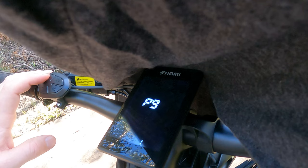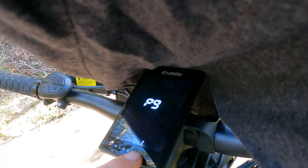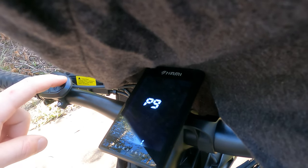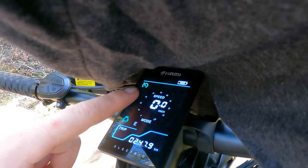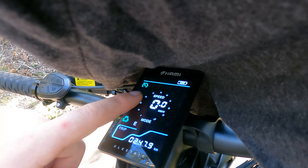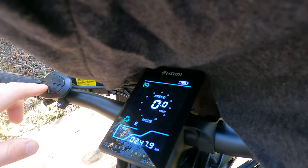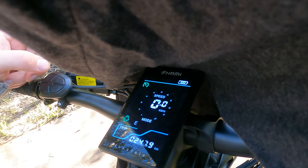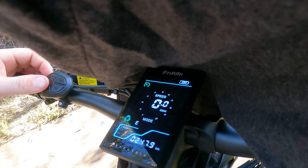P9 is actually your cruise control. I like my cruise control so I have activated it by putting it into 1. If we back out of this menu, you'll see in the top left hand corner you have a little segment there. When you're driving along to activate cruise control, you press minus down on your pad and that will activate it at whatever speed you'd like. You can then press up or down on the D-pad to increase your speed or slow it down.